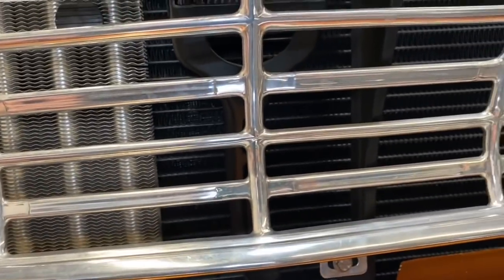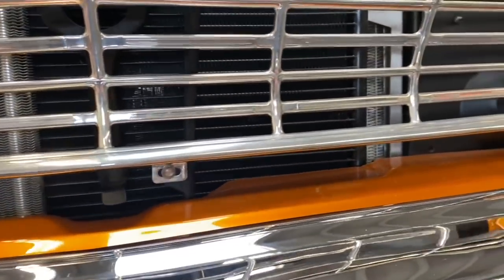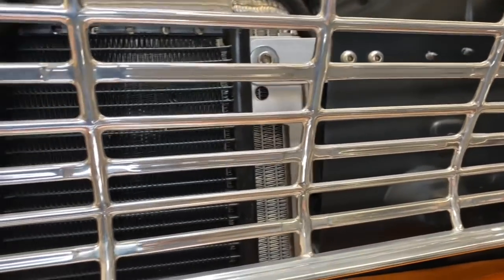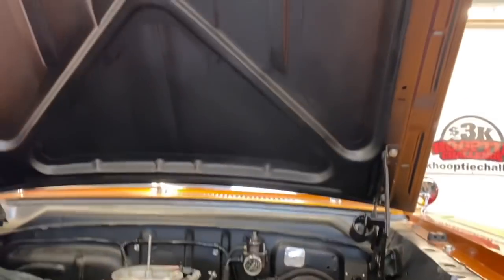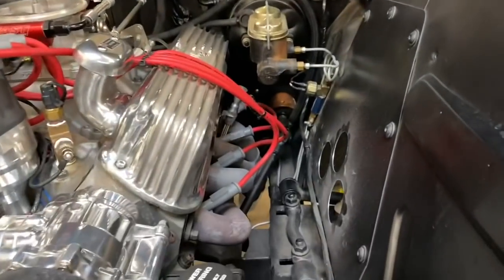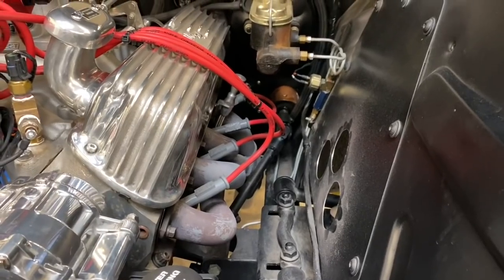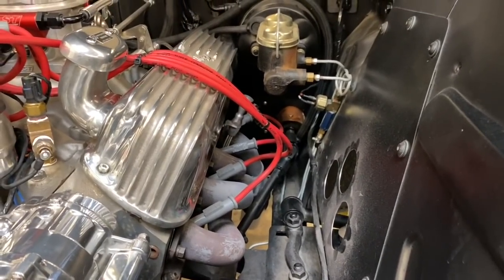The radiator is also being heated by the AC condenser and the trans cooler — there's a whole stack of stuff out there making heat. When you move into a hot environment, you really want every bit of cold air into your motor. When the hood's closed, there are limited spots for air to exit — down past the headers — and that's really it.